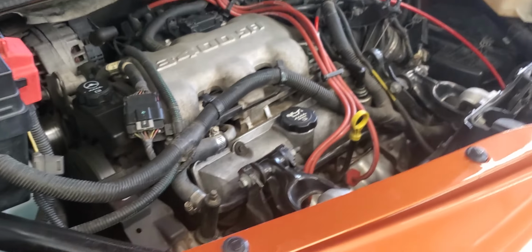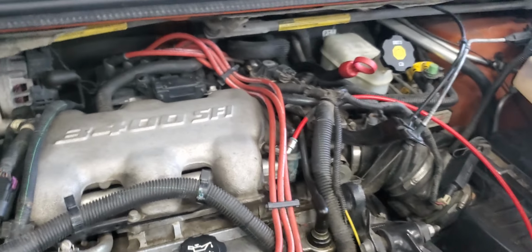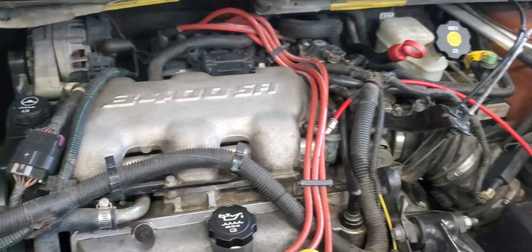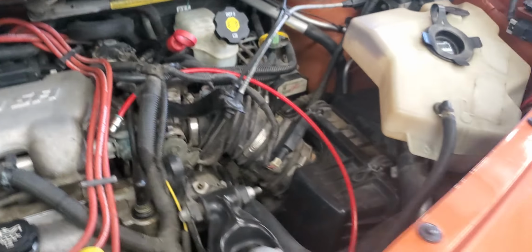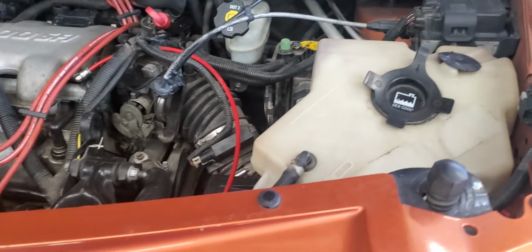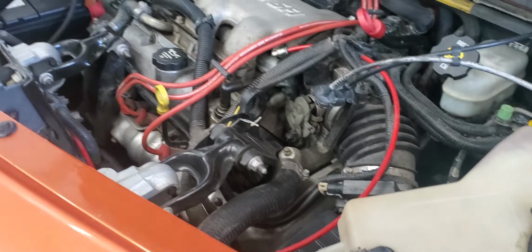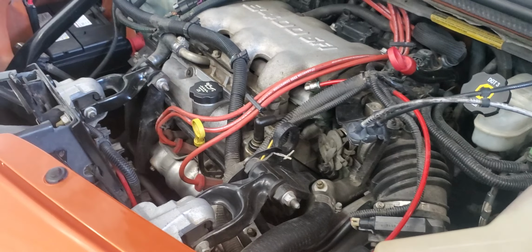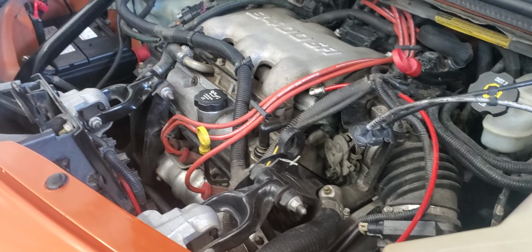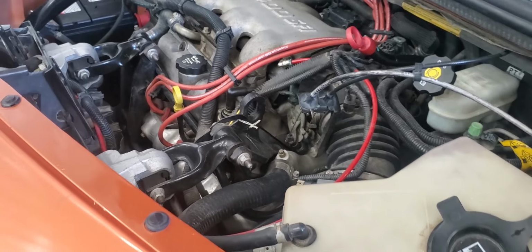So what we use for the water meth is -20, the cheap stuff, windshield washer fluid, and it's a mix of methanol and water. And even though we're in Kansas, even in freezing temperatures, it's just like your normal system. Your wipers work summer or winter. The Aztek has a low level sensor for that bottle, so it tells you when you need to add fluid, and you really don't need to add it very frequently on this car.